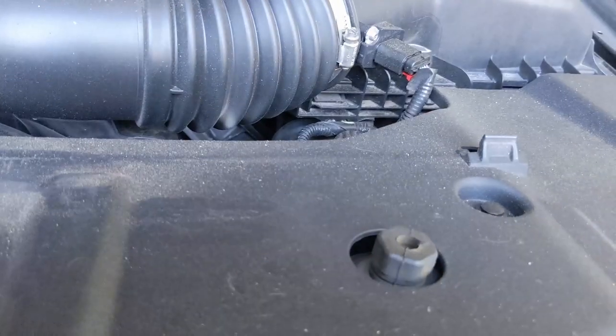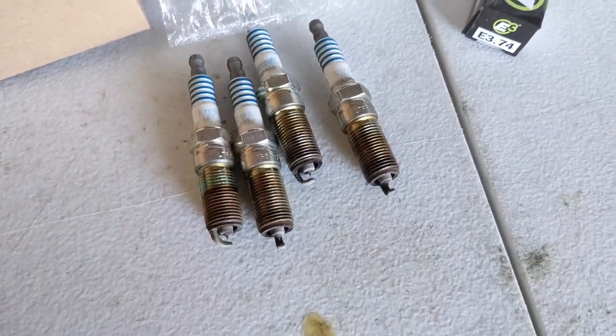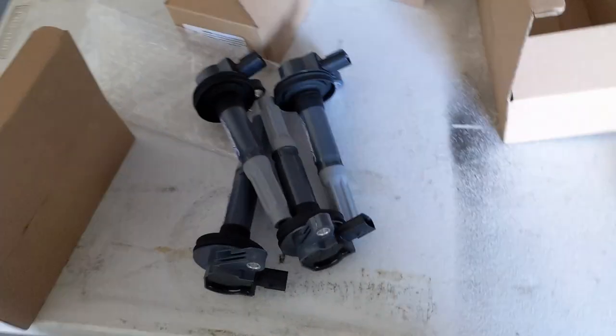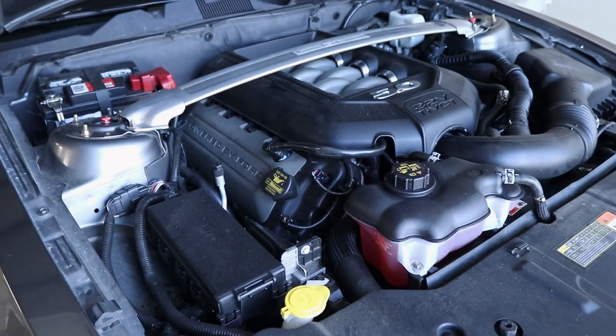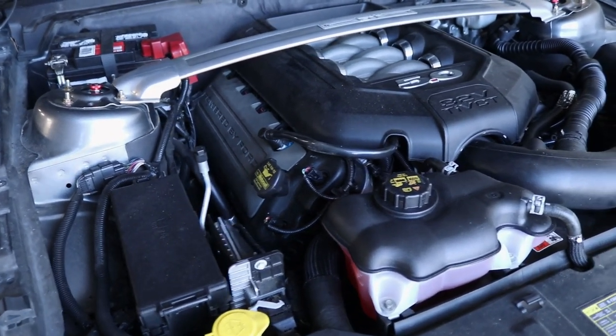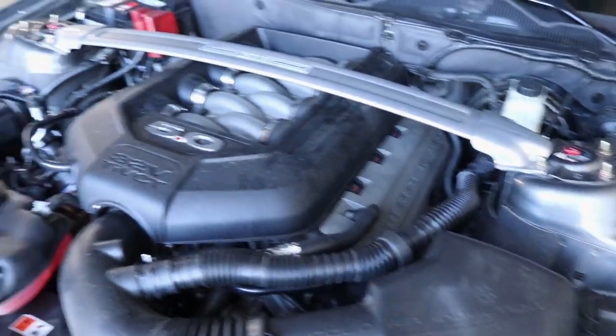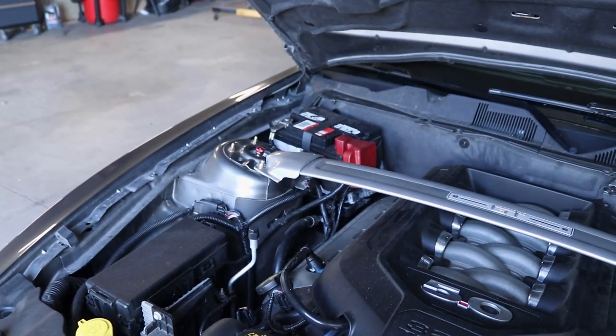Let's go ahead and change these out and see if the engine runs better. I got one bank of spark plugs out - they all look about the same. I've already put the new ones in there and now I'm just going to put the new coils in. That was actually a pretty simple job; it shouldn't take anybody more than an hour to do. It was pretty much just doing a reverse of what I did to take it apart, and I've already done both sides. This side was much easier than that side. There's a little battery in the back - I did have to take the battery out just to get to the back one. The only time it really messed up was when I was doing something like autocross or drag racing where I'm actually pushing the engine.